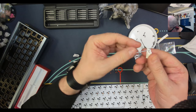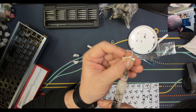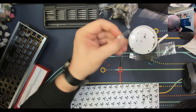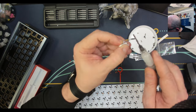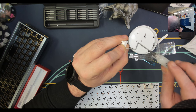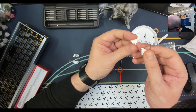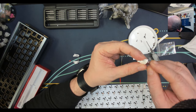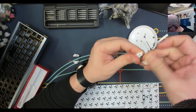All right. Same thing for the other side. Take the lube, little dab will do. Little goes a long way. Always remember. We take it up all the way past the elbow because there's contact there with the housing. And we just want to make sure that it has a nice sheen, almost like a skin of grease. All right, and we take it in. Make sure that we're all the way through. And make sure we're clipping it the right direction. There we go.